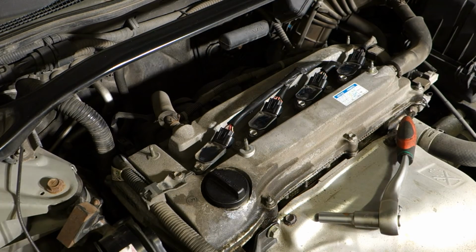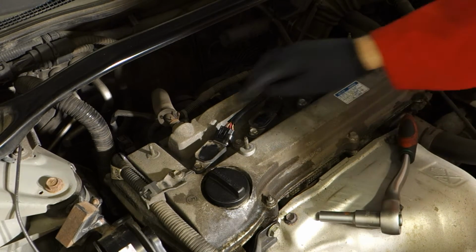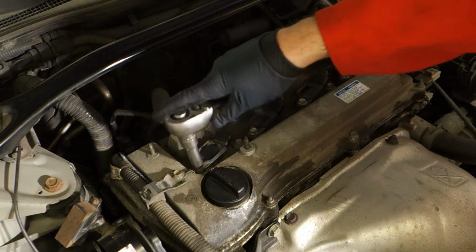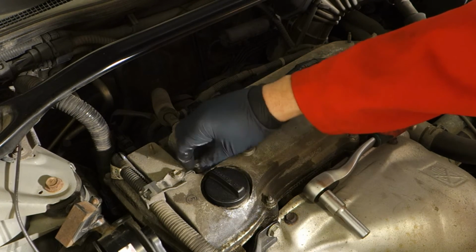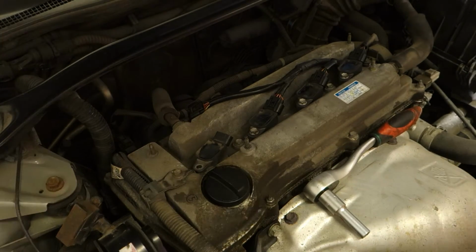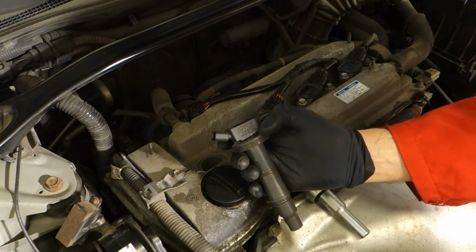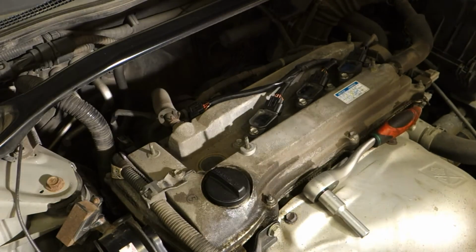Okay, and now I have a new view, and we continue with this ignition coil that we need to open. There is a possibility that we can press that part and take this cable out, so that we press in here and then pull out, and then we need to open that bolt in this 10 mm frame. Toyota's bolts open normally really easily. There is this 10 mm bolt, and then I can take my hand in here, move that a little bit in this way and then pull out, and this is the ignition coil. It looks like that, and when we rotate that, there is this Toyota Denso marking in here that it is made in Japan.